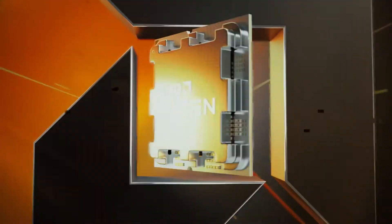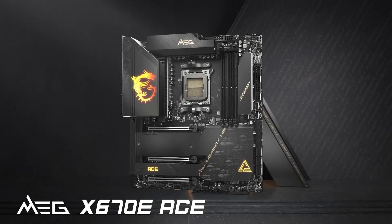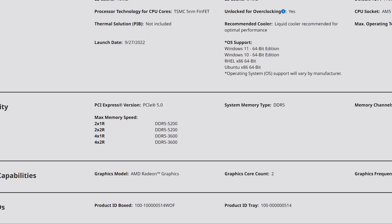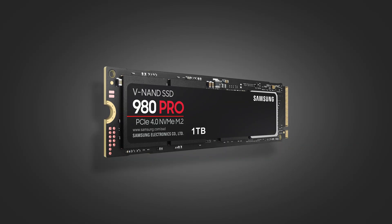The systems I'll be comparing are actually identical — two identical boxes. They're using the AMD Ryzen 7950X as well as an MSI X670E ACE motherboard. I'm going to be using 128 gigs of RAM running at 3600 megatransfers — that's due to AMD's limitation when you add more than 64 gigs into one of these desktop motherboards, you have to run the RAM a little bit slower. They're using Samsung 980 Pro one terabyte NVMes and they have a 1300 watt power supply. Other than the graphic cards, the systems are identical — the cooling systems, the case, everything. So it'll be a real apples to apples comparison.